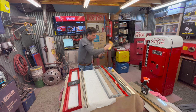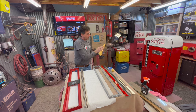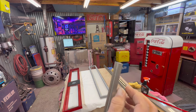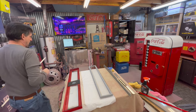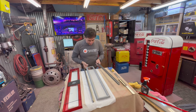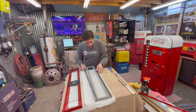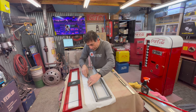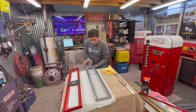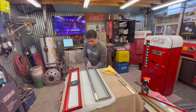When you're doing this, the glass needs to be the piece that goes on the outside of the door, not on the inside. Your big plastic piece will go on the inside. You're going to have a long piece, a wider piece, and then a narrow piece. The wider piece is going to go on the plastic side — make sure your rail's fat side is on the plastic side. Get that started first, lay that in there, and then your next piece will be your gasket. Pop this last rail in, feed it through the bottom side just like so.